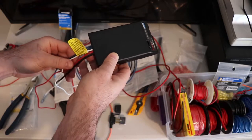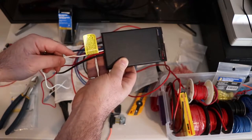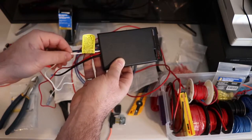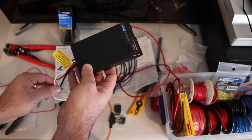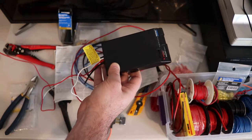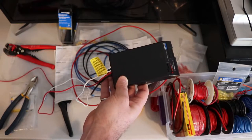There are a couple of different wire gauges on this unit. The ground doesn't need to be very big because it's supposed to go through the trailer — we go in through the positive and out to the trailer, so the ground is only to operate the base unit. The brakes don't get grounded through that. The stop lamp switch wire is a bit longer and might reach without being extended.